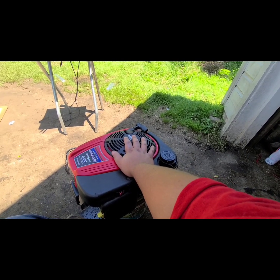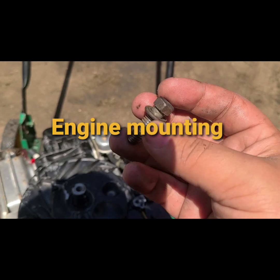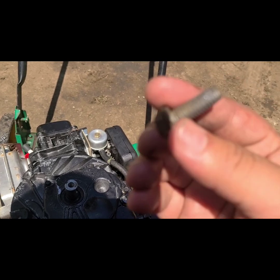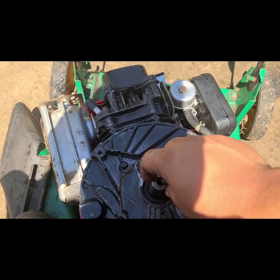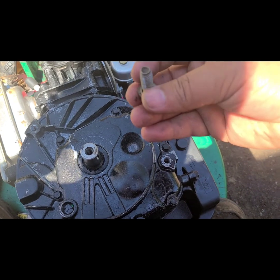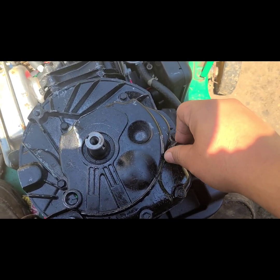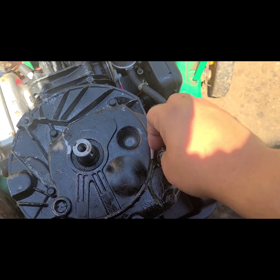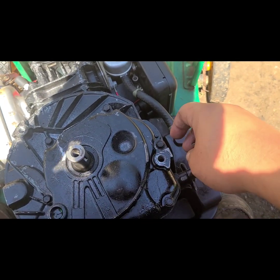I'm going to go over the preparation stage. I've decided I'm going to use these standard 13 millimeter push mower motor mount bolts. This is a 13 millimeter head and it's got a built-in lock washer with that triangle shape. Now even though this motor is already set up in a three-hole mounting configuration just like a push mower engine, I still had to re-thread these holes because I had trouble getting these bolts to go in the first time. If you have a tap set you can do this, but this is an aluminum block so it's easy.